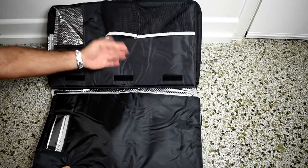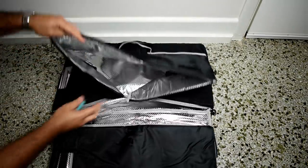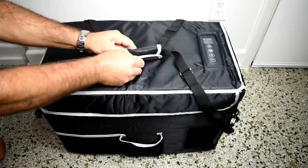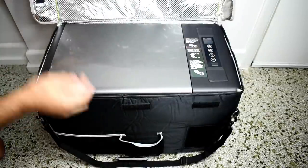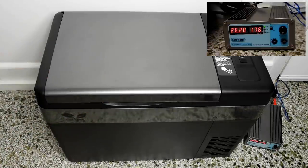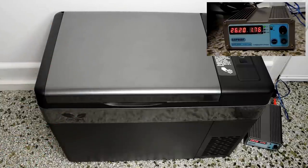The company sells an optional insulated carry bag. You can operate the cooler while it's inside the bag, which has a shoulder strap for easier carrying. The biggest benefit is energy savings — the added insulation means the unit cycles less. Testing at 24 volts works perfectly. With two batteries in series there's no problem powering the unit; the current draw is only 1.75 amps since the voltage is doubled.